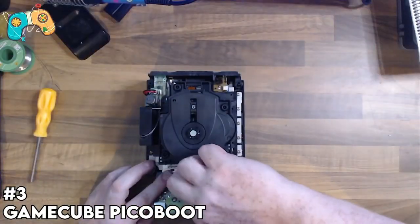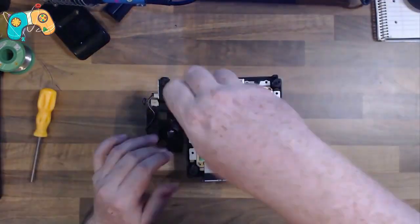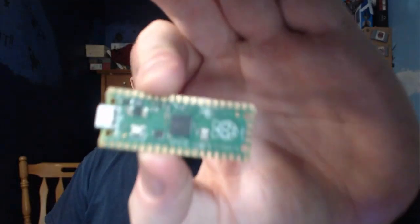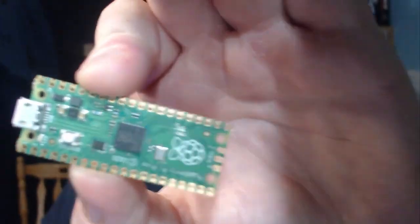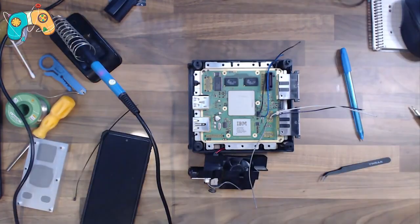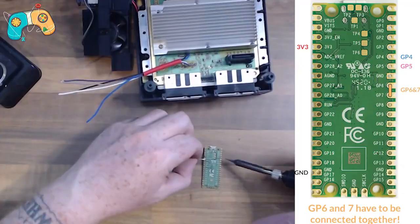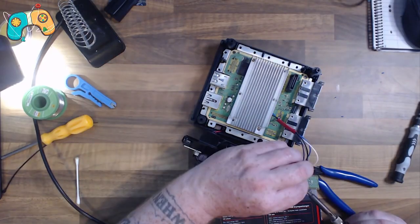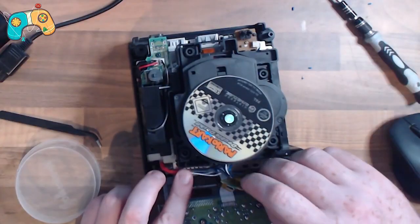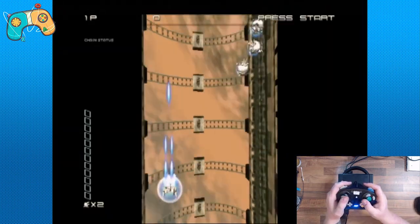I think this is actually the first Raspberry Pi Pico project I installed — this is the GameCube Pico Boot. Similar to the Xbox, you throw this into the GameCube, wire it up, and it lets you boot Swiss off an SD card. This was a relatively simple install — flashing the Pico is absolutely no bother, though there is some fine soldering involved. As a beginner it wasn't the easiest, but it did work. It lets you boot Swiss and play games off an SD card. Definitely worth it — fun!